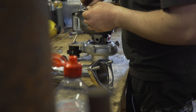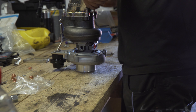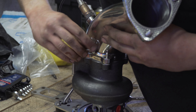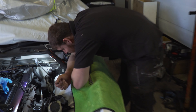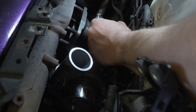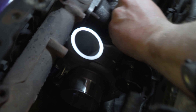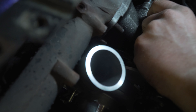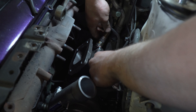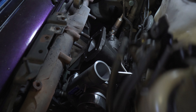We're looking to mount the new turbo in the bay and working out whether we need the spacer or not. It looks like we do — if Oli places the turbo on its studs, everything looks like it'll clear, but then you realize how close the compressor cover outlet is to the exhaust manifold, and we've got to get a silicon connector on there, which isn't great for heat either. The spacer comes with the Mamba kit, so it's handy, and we'll shove that on and see if it clears.